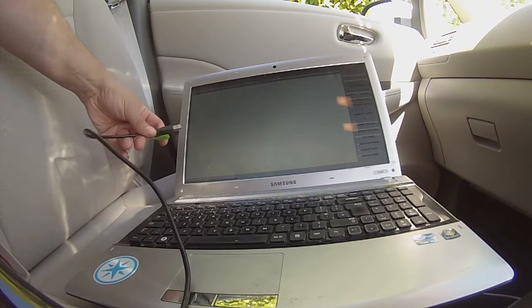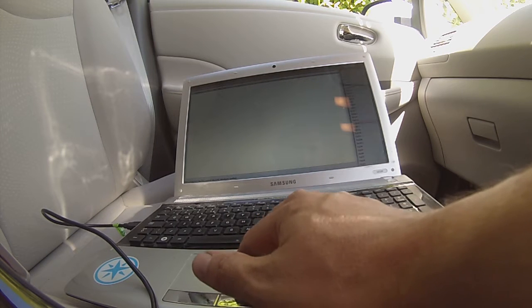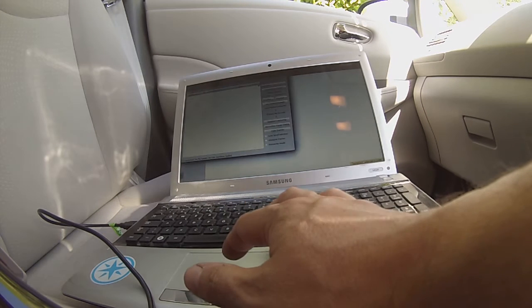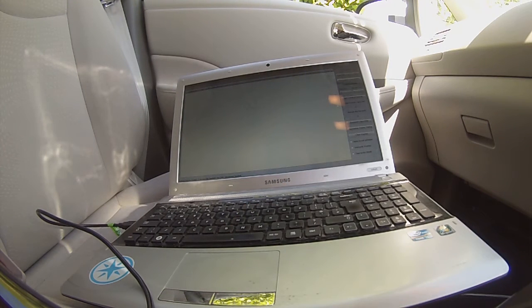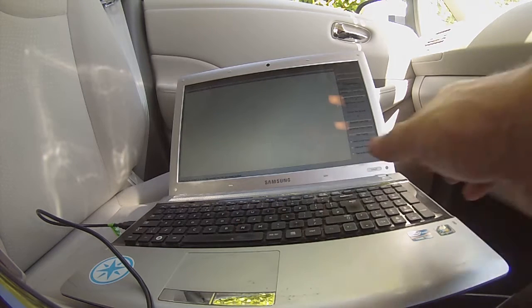I'm going to connect my USB lead. USB is in and the Arduino is powered up. So we should be able to connect on... Oops. Okay, looks like SavvyCAN needs to be started after we plug in, so let's try that again. Yeah, it's picked up ACM0 and connect to GVRET. So it says here we're connected to GVRET 316. Unfortunately on that board I've no EEPROM chip, so I need to reset my bus speeds here to 500k and set CAN bus speeds.